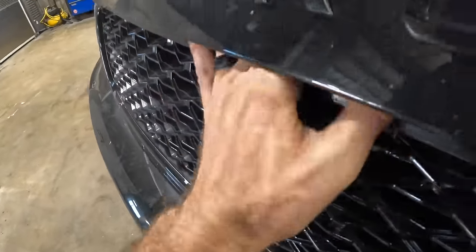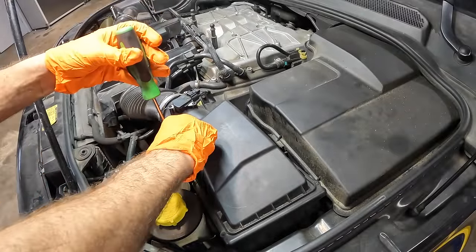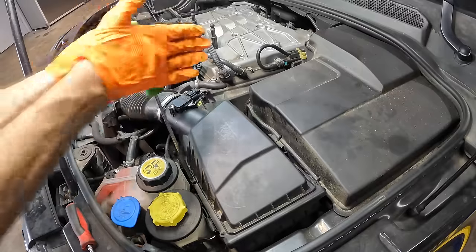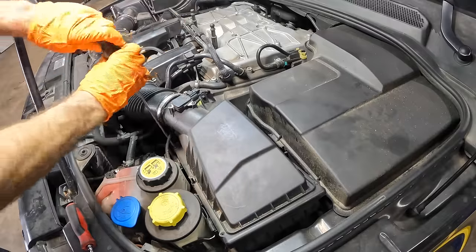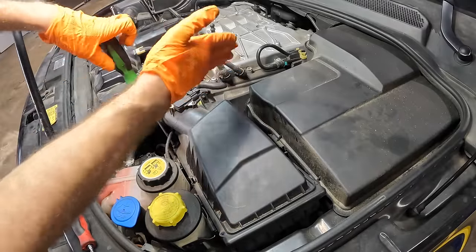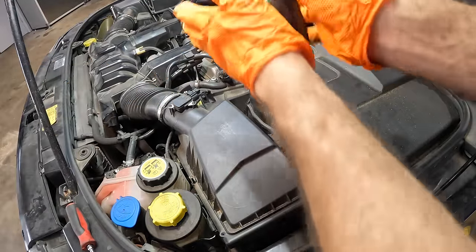Where's my hood release? Those fancy Euro levers — there we go. Supercharged. I guess the best place to start is the beginning, and most beginnings of engine repairs are going to start with the air filter and intake tubing. So let's get this stuff disconnected and unplugged. We can start peeling back some of these covers. We've got to get to this foam molded insert type of thing that goes over the cylinder head on this side, and one more on the other side. Let's get those removed — that should give us access to our coils.